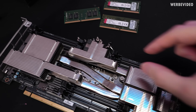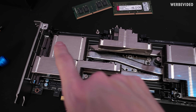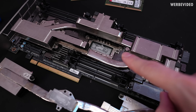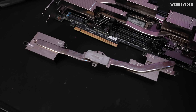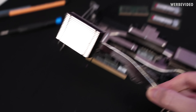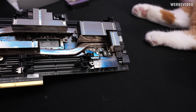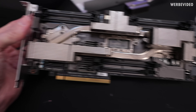I first thought I could simply take out the top memory DIMM, but they are stacked above each other, so we first have to remove the heat pipe in the center. After removing it, I can see these CPUs use a normal notebook-style cooler making contact with a tiny cooling block and two fin stacks on each end. The second heatsink to remove is for the CPU on the left, and the third is beneath it on the right.